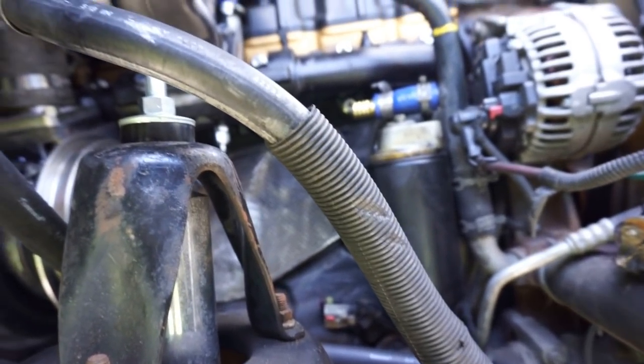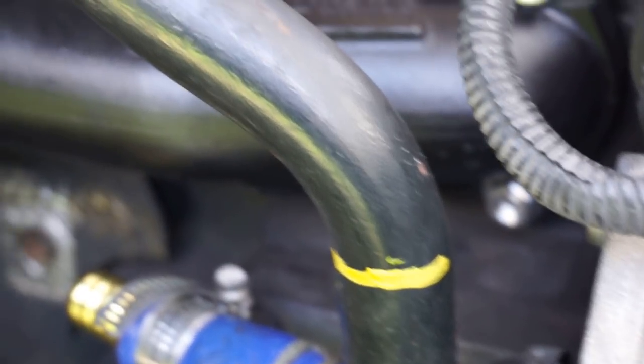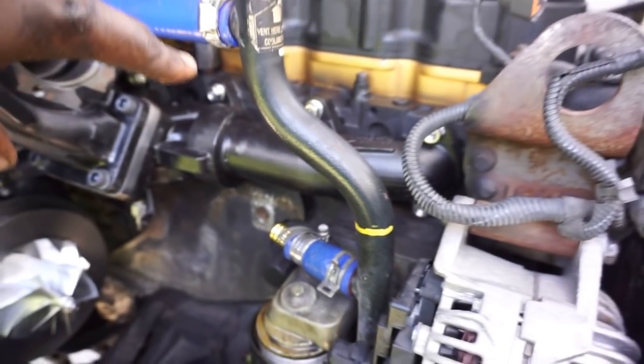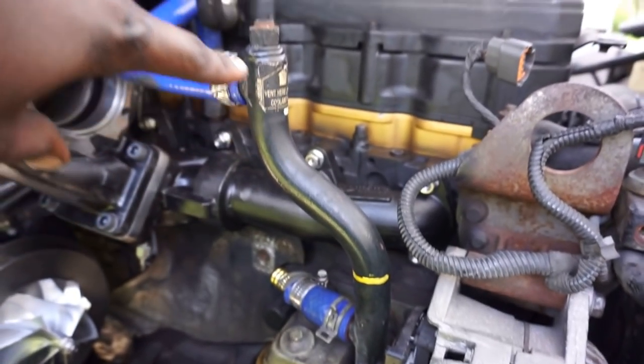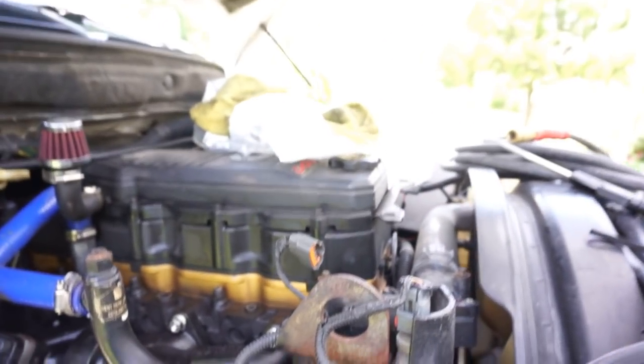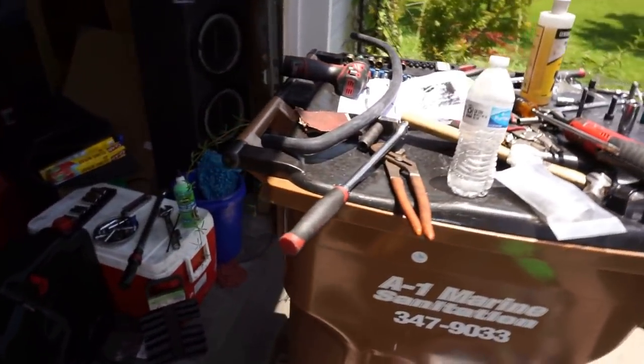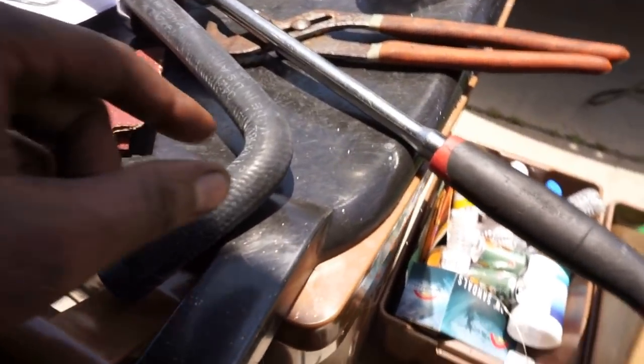But everything's looking good right now, you guys. Next thing we're going to be doing is the coolant riser delete kit from Pusher. I already made my marking where I'm going to cut. So long story short, what happens with this kit is you cut right there to remove that top piece, take off the hose, and then Pusher provides you with a new coolant hose with a pre-made, pre-bent 90 in it.